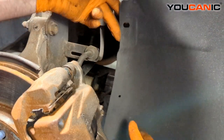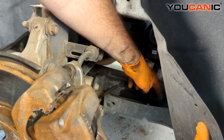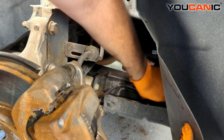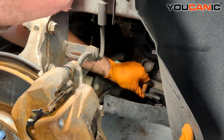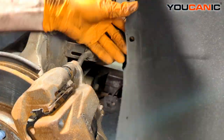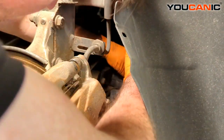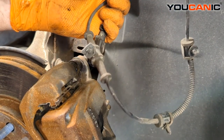Remove some push pins here and you're able to pull the liner back. Reach up in here — we've got one more clip right there. We also have the electrical connector right up in here. Squeeze it and pull it undone, then there's a little tab on the back — move that and you should be able to pull it off. We've got it all off. Pull this all out and free it, and that is our front ABS wheel speed sensor — it has been removed.